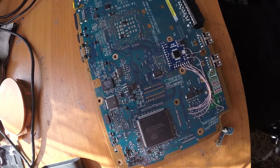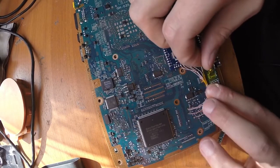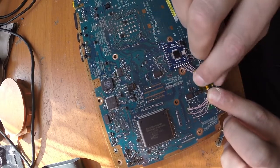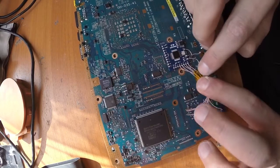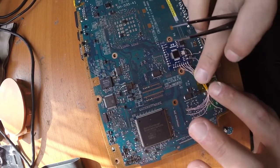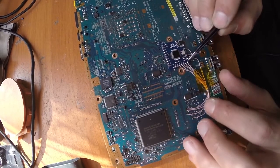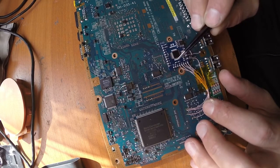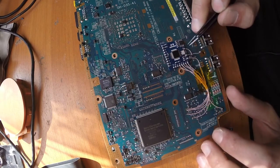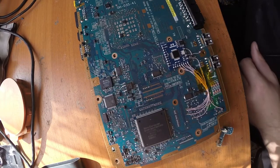Off those pads and also damage something. So here for a while I will use soldering tape just to hold the wires together, but after I finish wire routing I will use just a bit of hot glue to keep them nice and steady, like so. Okay, so we finished our points A, E, H, G, and B. Our reset point, ground, and 3.3 volt line. So we have quite a bit of soldering still left. Let's go and do that.